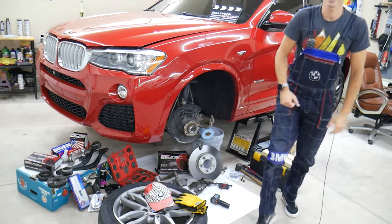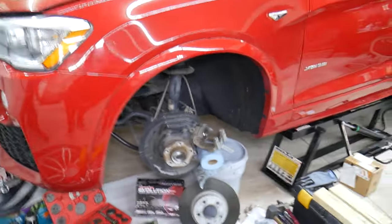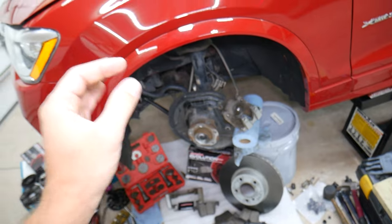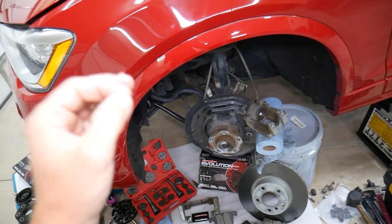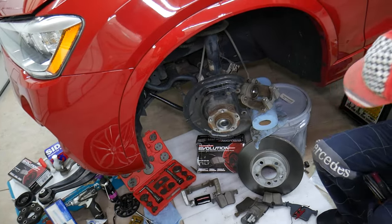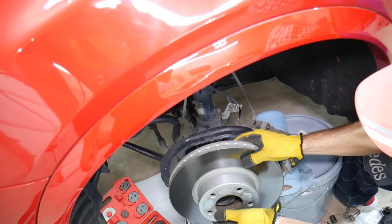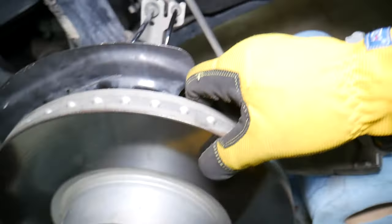So how you can really easily diagnose that — we'll be demonstrating on a BMW X4, but even if you have a different car, it will work as well. First, I can't emphasize this enough: in your service manual on every BMW, it will say how often you need to change the brake fluid. You need to actually replace your brake fluid — it's not a lifetime deal. Often people will ignore that, and ignoring that will mean that the brake fluid will lose its characteristics, and that can even cause build-up inside.